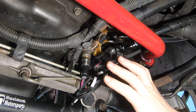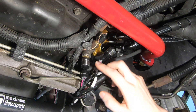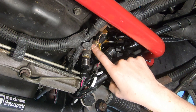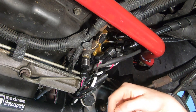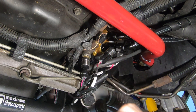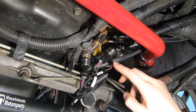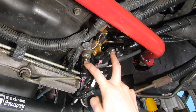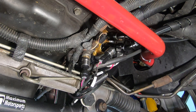Take a look at the bottom of the car — these are all my engine oil sensors, covering engine oil pressure and temperature. The factory has a test port built into the boss where the factory oil pressure switch lives. I just took out the blank plug, threaded my sensor into the test port, and I'm reading oil pressure right where the factory does. In addition, I'm also reading oil pressure coming back from the cooler, so I can see the difference between the two pressure sensors on the iDash and get an alert if either one loses pressure.